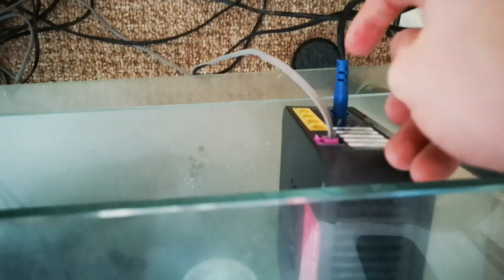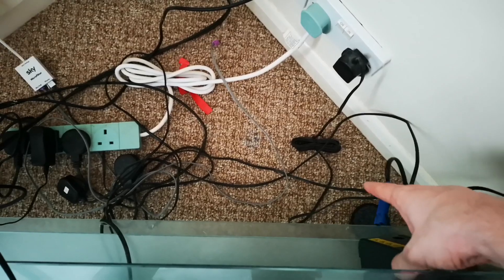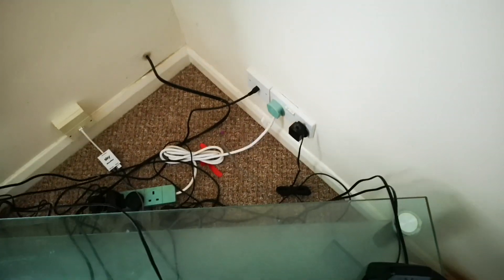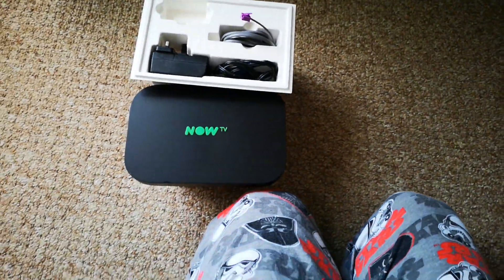So if you have a Sky Hub, it will look something like this or similar. The Ethernet cable connects the hub to the internet — you can remove that. Then the power: always use the power that comes with the new hub, because the power delivery won't always be the same as your old hub. We're also going to be changing the microfilter over to the one supplied. You don't have to do that, but it's good practice, because you can get a build-up of so-called dirty data which will slow down or cause intermittent internet.